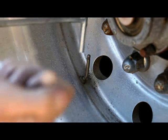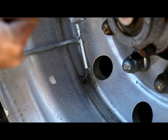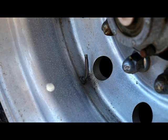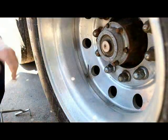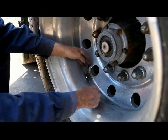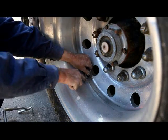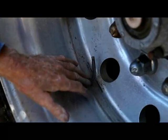So now to bend it. Simply put the adjuster on the valve like that and bend it down till it touches the rim. Now you know you have plenty of clearance in the head. Also, just make sure that once you have bent it down, that the nut is tight. If you don't, the machine can undo the nut as it runs.